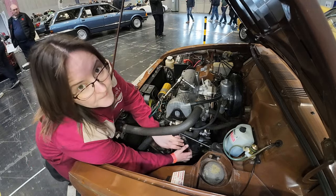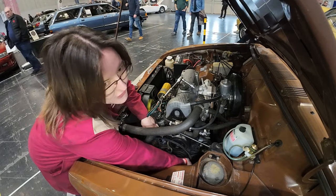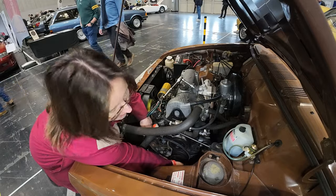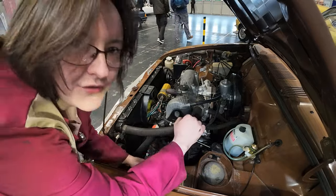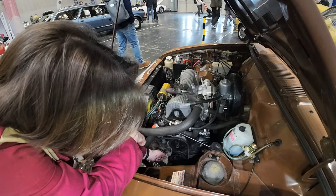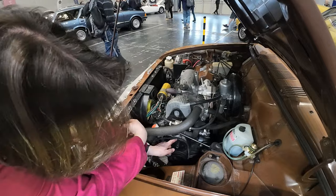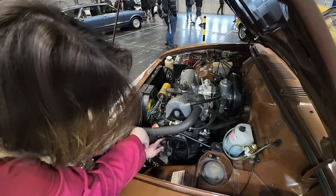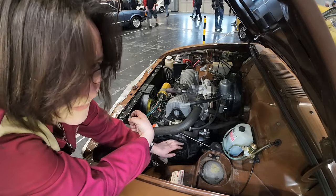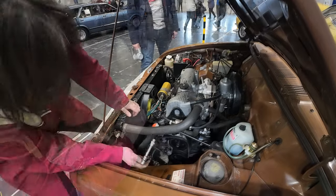Got to watch the bottom pulley. It looks like two slots to put the belt, but it's not two slots, it's the inner one. I got interrupted by people talking to me, but I took that bottom bracket off completely, just to get enough play to get the belt on. I managed to just get it on the edge there, then get a socket onto that and pull the belt over. So feed it on, so it's on there now. I just got to tighten it up.